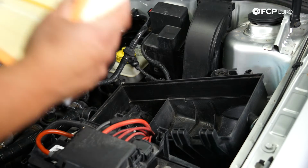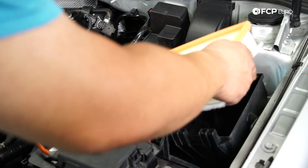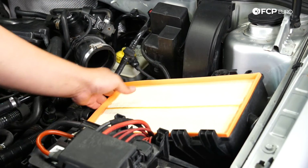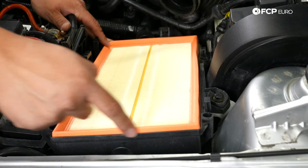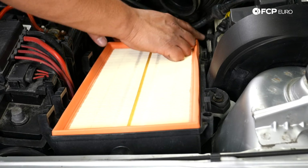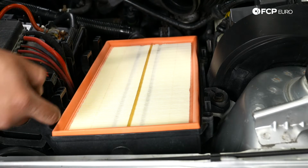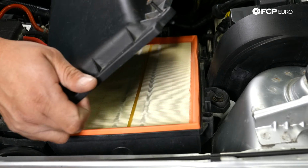This is going to face down. Our orange seal is going to be right up here where the two lids made up. Just place that in. Going to make sure it's nicely tucked in on all four corners. So again, that orange seal is going to tuck in nicely just on the inner lip of this outer edge of the bottom portion of our box. And then we can take our lid, and you have the four little tabs that go under each notch here to hook that back in.